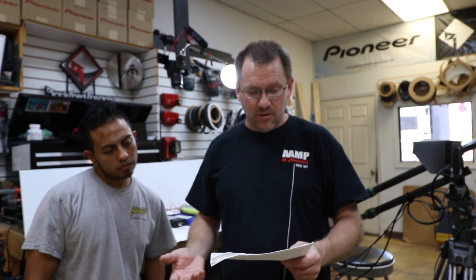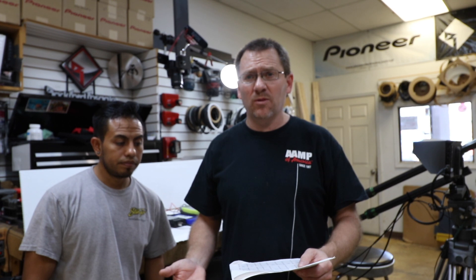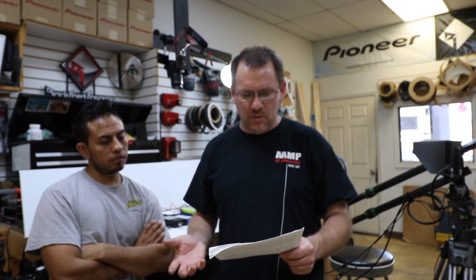I don't understand why Alpine did that — that's really freaky. Auxiliary, you had to bump it up to 12; USB, 7; Bluetooth, 6; HDMI, 6. That's a lot — it's nearly half its voltage as the default. 2.1 volts out of the box, except for aux which was 1.1 volts. So I don't know what they were thinking. You clearly get the output voltage you need — 4.2 volts mainly, some a little higher. USB was a little higher.